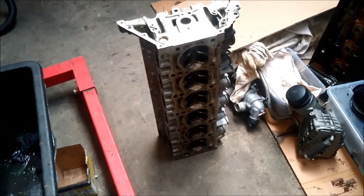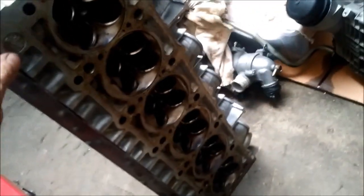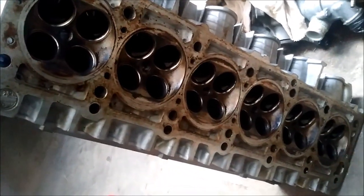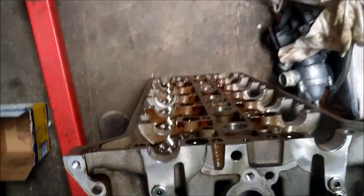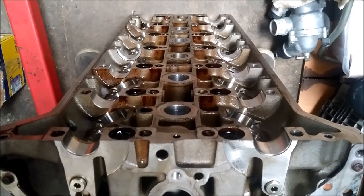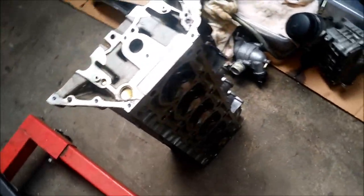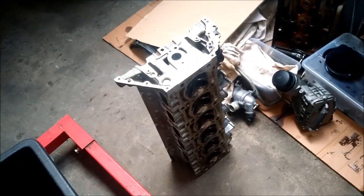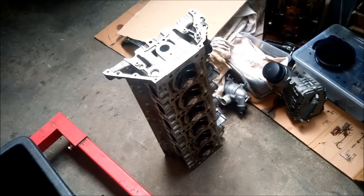Same with the cylinder head. The condition is quite good. I also measured the surface and it's perfectly straight. The valve seats look okay, no damage whatsoever. The only thing was there were a little bit of scratches on the bearings for the camshafts but I think it's not very bad so I will just use it like this. I will also get it resurfaced and cleaned. I will not start modifying it in a big way — no porting or anything like that. I will just use the regular sizes and regular parts.